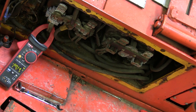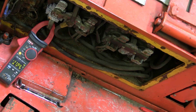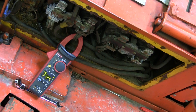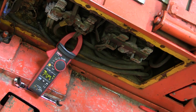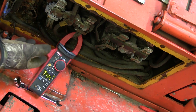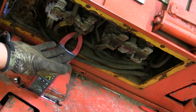This is the interesting part of electrical troubleshooting because voltage is not everything. You can have lots of voltage, but if you have high resistance in the conductors because they're old or crappy, then you don't get enough current. And current is torque. So we are going to measure the current coming through these conductors and see in forward and reverse what we're getting. Here's the forward contact: 123 amps - nothing to sneeze at. Here's the reverse contact. I wasn't expecting that.